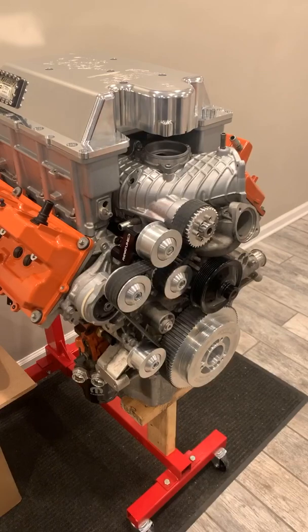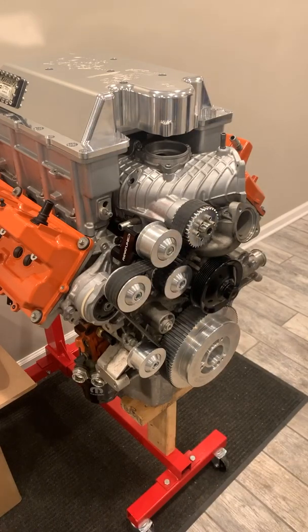The efficiency of this — if this guy is picking up 8 pounds of boost with the exact same amount of blower rotation, we're really going to see the stock blower shine. There may not be as much need to swap blowers as before, when you'd max these out at 20 to 21 pounds and they'd fall out of their efficiency range. Now we can run a much larger pulley combo. This blower with a 310 upper and this lower makes 21 pounds of boost — which is insane. We actually have a 310 on here right now.